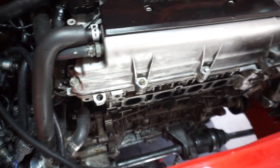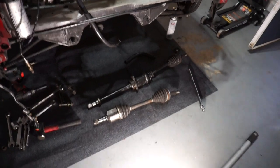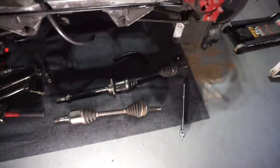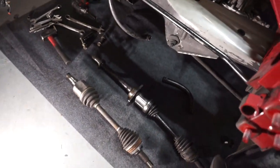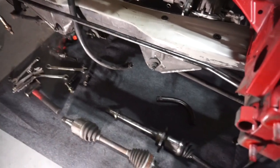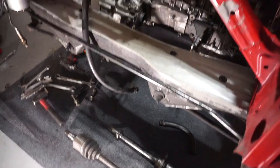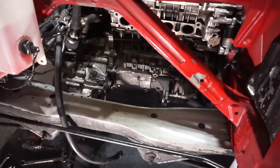Let's remove the axles — the axle nuts and the axles. Both axles are now out. I'm gonna buy new ones. The axle seal joint tore right here — look at the difference: that one's an '03 and one's not. This one's fat. I'm gonna get the bigger upgraded ones. This thing only does max 175 pounds of torque, not very much, but it'd be nice to have the matching ones. We'll look on Monkey Wrench Racing for axles.